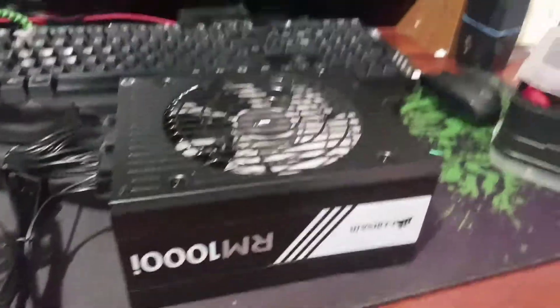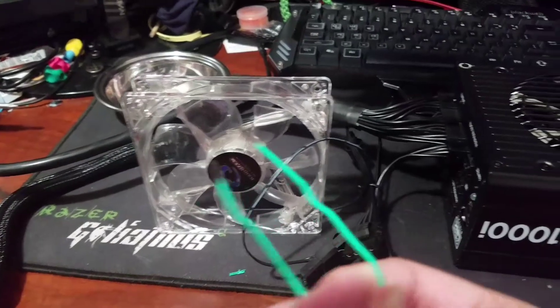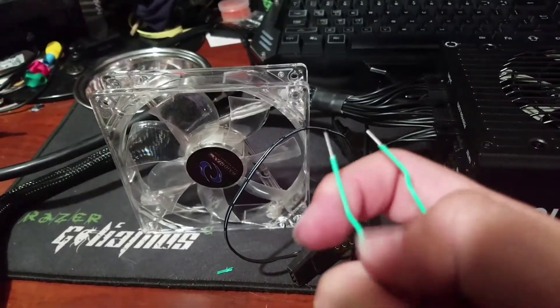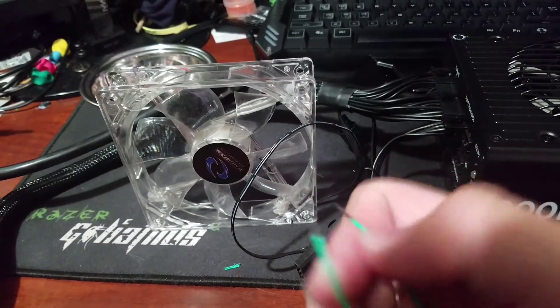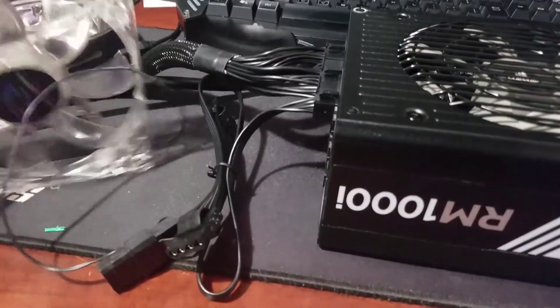So, after work today — now 4:30 in the afternoon, I'm recording this — I decided it's time to test this thing. I've taken it apart and I have the power supply sitting here. First thing we need is a paper clip, preferably not one with the plastic on it. In this case, I had to cut the plastic away because we're going to need it very soon. First thing you want to do is probably remove the PSU from your case and disconnect everything from it. You're going to need your motherboard connector connected to it, and you're probably going to need some sort of load — in this case, a Molex-based fan.